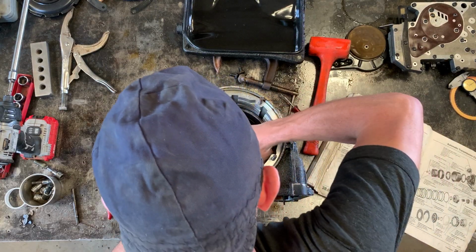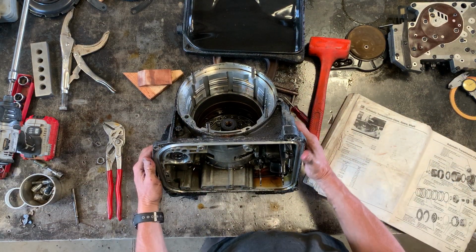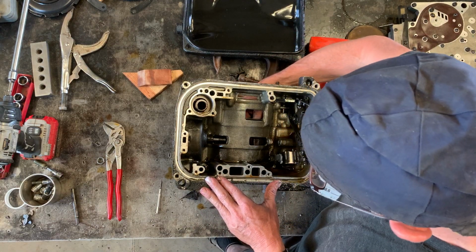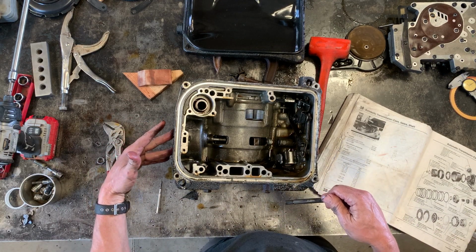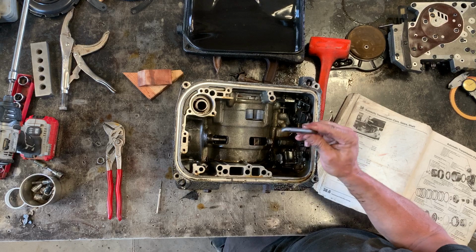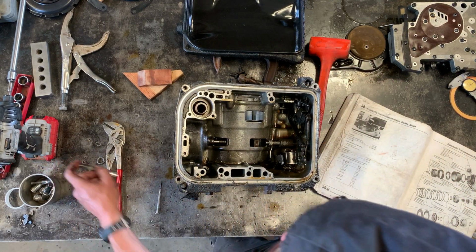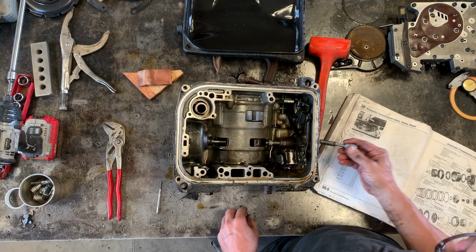And again, we're now getting into the reason why I found it nice to have the valve body removed, because with the valve body removed, which normally goes here, you have good access to making sure these rods are properly engaging with the brake band. So on the one side, it's actuated by this spring-loaded piston. On the other side, it is not actuated at all, but it is tensioned and adjusted with this rod, which comes in through the side of the case, and which is then tensioned with this set screw, which also has a lock washer, lock nut.